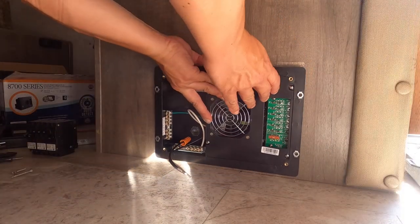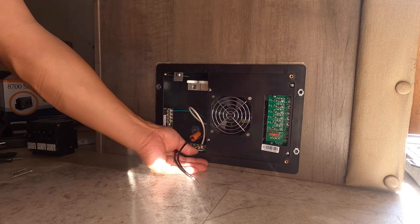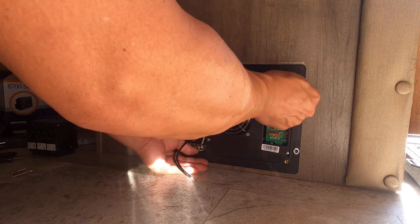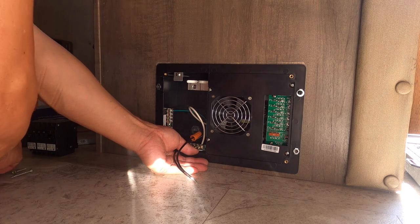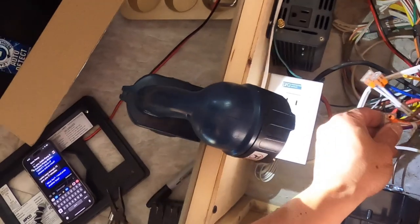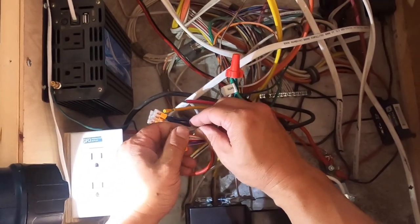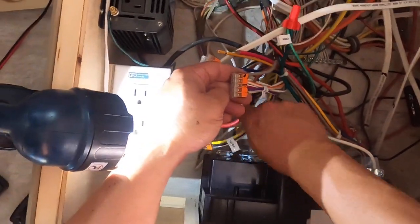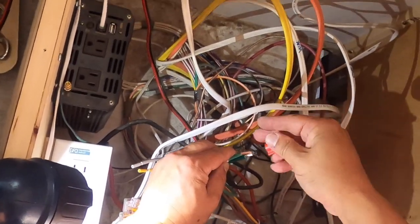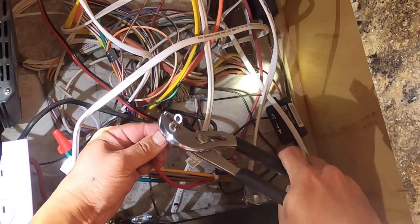Fortunately, the new power center is exactly the same size as the old one, so this made the project a bit simpler. Now that you've seen how all the wires are connected, it kind of makes sense how to reconnect everything — it just takes some time and stretching your back every so often so you don't cramp up. Reconnect all the colored 12-volt wires into their corresponding flip connectors, then the white wire back to the RV bus bar. I used a wire connector for the ground wire and attached a ring terminal to the red wire so it could be secured to the post that leads to the battery.